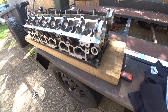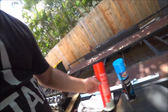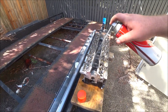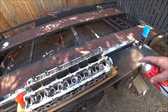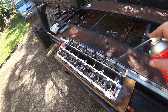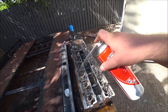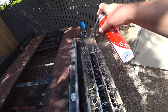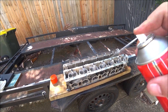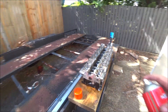After pulling out all the valve stem seals, brought the old girl out here. It's still got that awesome blast tape on the machine side and you can see in here it's still covered in grime. So I've got here some brake cleaner and some degreaser. Step one - degreaser, slam it in there. The reason I haven't bothered pulling the cam caps off is I already cleaned under those when I pulled them off, and I'll give them a proper clean as part of the assembly process. This process is to get rid of all the general build-up of carbon, oil, dirt, and all the swarf from where I did the exhaust ports.